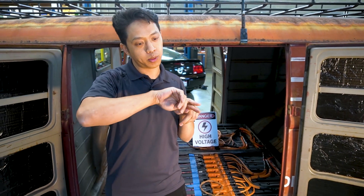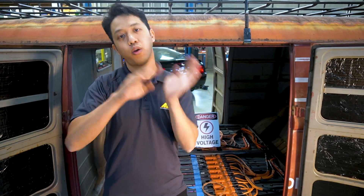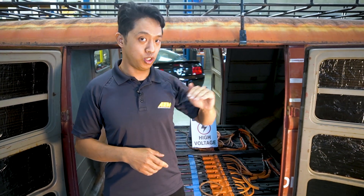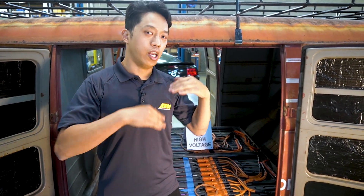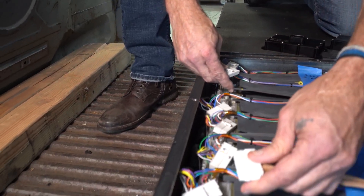This vehicle is equipped with chargers programmed specifically for it, with a specific charging curve. As the voltage comes up towards maximum capacity, the current the chargers deliver drops off to avoid overcharging. With our VCU monitoring the system, we can ram the battery with as much charge current as the charger can supply. As it gets near the limit, the VCU watches it, turns the charger off as needed, lets the voltage sink back down as charging current goes away, checks again, and if needed turns the charger back on — repeating until the battery is topped off. This allows us to reach maximum capacity in a shorter time.